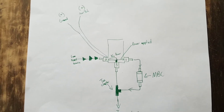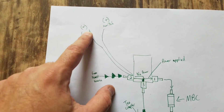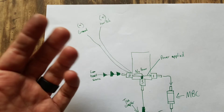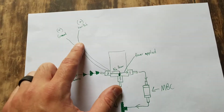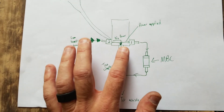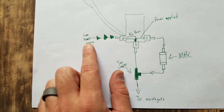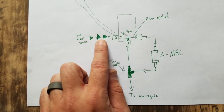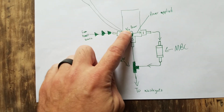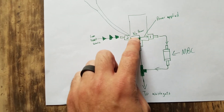Okay, now the electronic portion — a little more complex but really not too much. This is the three-port boost solenoid. The wires: one goes to ground and one goes to positive — you can wire a switch to turn it on and off. On the one I purchased the ports are numbered one, two, and three. Port two is going to be from the boost source, coming off the turbo. With no power it goes directly to three, but with power on it goes to one.